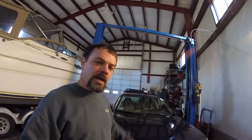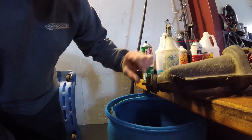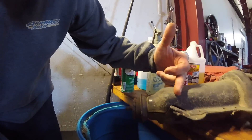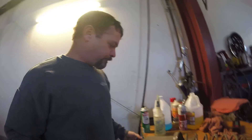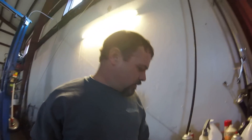Basically what I'm going to have to do is change where the shock mount is on the strut tower. I'll cut the top off however many inches the lift ends up being and remount that piece further down in the bucket, so the shock is actually lower. That way when the suspension travels it won't hit the bump stops built inside the shocks. I've also got coil spring adjusters up on the rack that we looked at in a previous video.